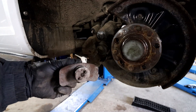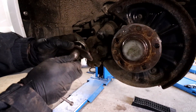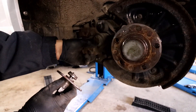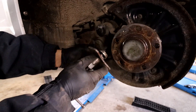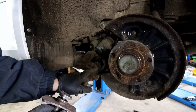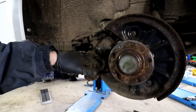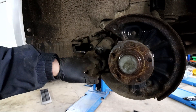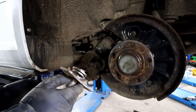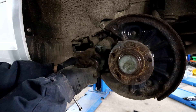This is the tool I'm going to be using — it will be in the description below. You've got different adapters for it — that's the caliper retraction tool for the rear ones. You literally position it in there and find the locators. There are different adapters because there are different cutouts on the actual piston. There's a little bit of liquid on there — it's not brake fluid, don't worry. I usually like to spray a bit of silicone spray or WD-40 just where the rubber joins the piston for it to be easier to slide. It makes it easier so the rubber doesn't get stuck on the piston and stretches too much or rips.